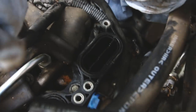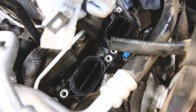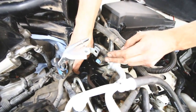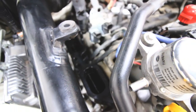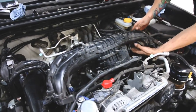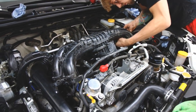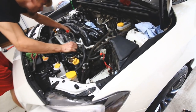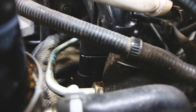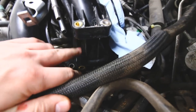We've got the lower or bottom part of the TGV put back in place. Put those back in on each side. Here on top of your lower it'll line up with your four bolt holes for your intake, and then the other one on the passenger side. We can put the top manifold back into place now, lining it up with all of the bolt holes on the TGV deletes and bolt everything back up together. The bolts go straight through everything so you've got to line it all up. They're a nice subtle black — goes well with the color of everything in the engine. Once you've got them in place, the last step is just to bolt everything back up together.